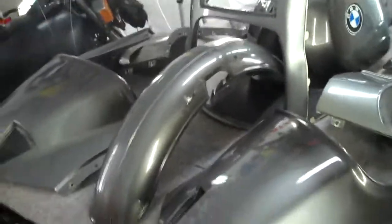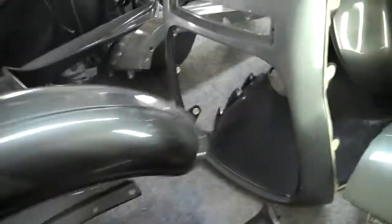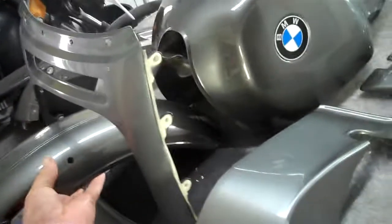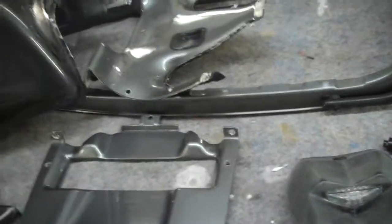I'm soaking this in. See how that fade just goes along the edge of that panel there? Maybe not even enough. This bike's been through different paint jobs, I think. We're going to get it all one color and go with a waterborne. The base color is going to be a waterborne. And then some airbrushing. And then Envirobase clear — going to go back with that clear. I'm liking that clear; that's what I've been using, I'm not having any problems. So just a quick video to throw it up there so you guys know I'm with you.